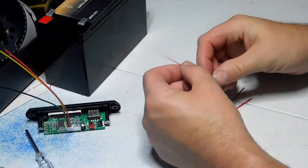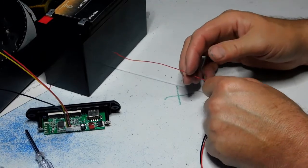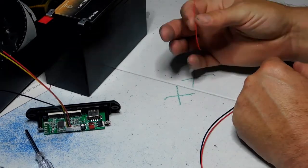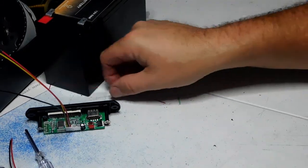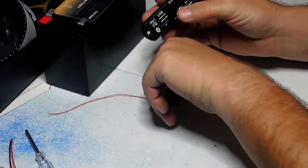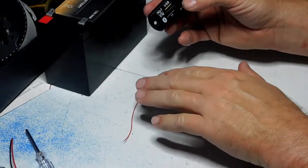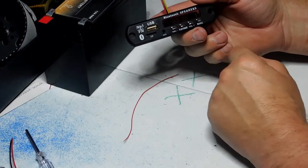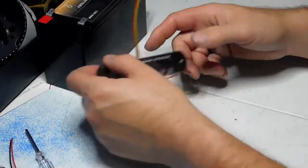You can do two things for the antenna. You can take a long wire — about 15 feet or so — and make a loop inside your project, which gives you a good FM antenna. Now if you're using these on a metal ammo can, a metal box, or metal toolbox, that's probably not going to work very well because the metal will shield the wiring. You'll need to get the antenna outside the box.